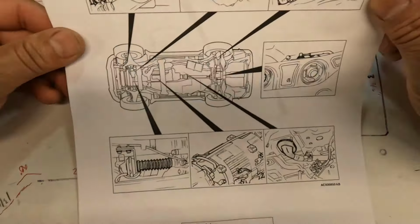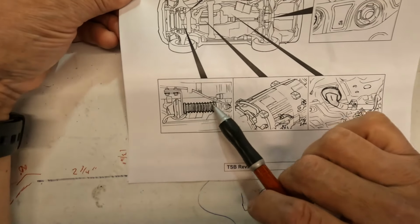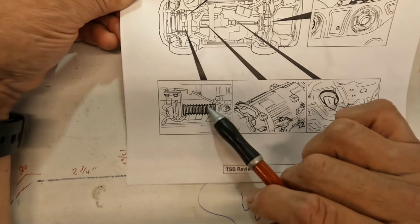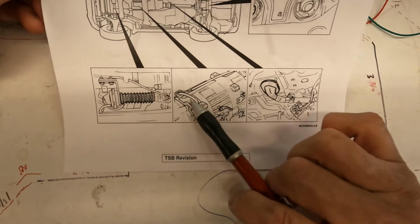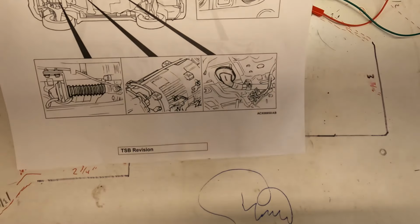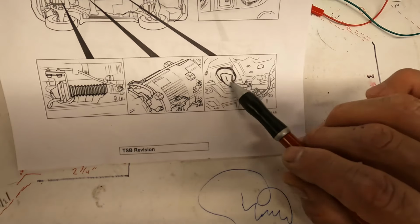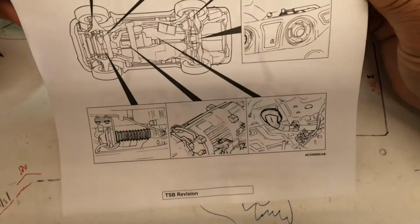So the other thing over in the front differential actuator, there's this little dust boot as well. So make sure that this is properly installed and there's no rips or cracks or anything like that on this component. Also the transfer case area, make sure everything is okay here. And then there's this other little section here on top that's like a grommet that goes through the bottom of the vehicle to the inside of the vehicle carrying wiring. So just make sure everything is seated properly right there. And I'll show you that under the vehicle here.